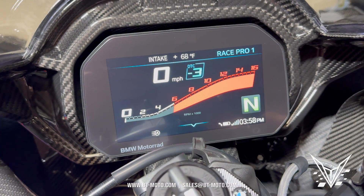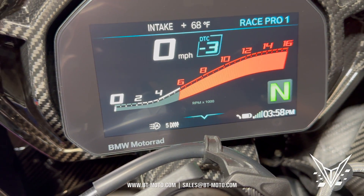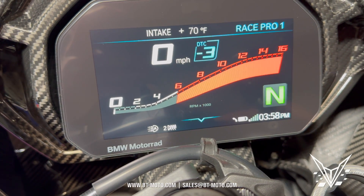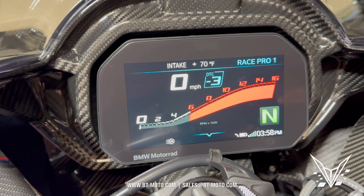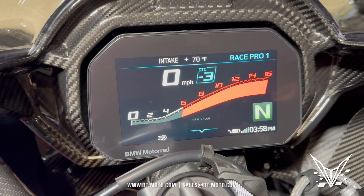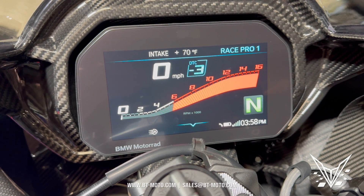Today I'm going to be showing you guys first the heated grips. Usually they only come with three steps, and you can see that at the bottom. Now I got five on this thing, and to me the five is really nice just because three is a little bit too hot and two is a little bit too cold. So when you split it up into five, three turns out to be a perfect riding temperature in my opinion.